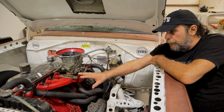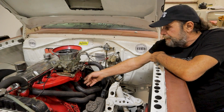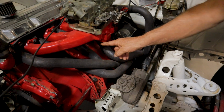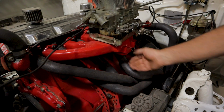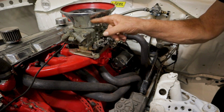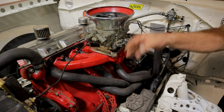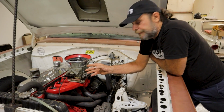So now what we're going to do is, I'm hesitant to add, I know a lot of you guys right away are going to say, well, add something, heat sinked from the header to the bottom of the plenum. I'm hesitant to do that yet. I may do that at some point, but for right now I want to work with this setup exactly the way it is and just let this car sit and idle, because now that we've fixed the idle circuitry on it, we've scaled the idle circuitry to the engine, it'll sit there and idle for an hour and never dirty the plugs.